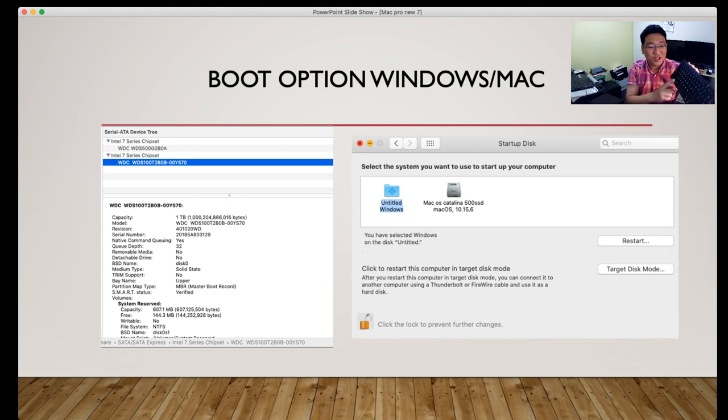You can also boot using the Option key when starting your Mac — just keep it pressed and a menu appears to choose either macOS or Windows 10. Make sure you hook up the Wi-Fi before booting into Windows 10, because if you don't, Windows 10 doesn't recognize the wireless adapter. There was also a Bluetooth issue — probably a driver issue — but I resolved it by using a USB Bluetooth adapter, so it was no big deal.